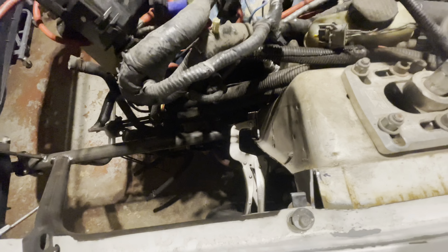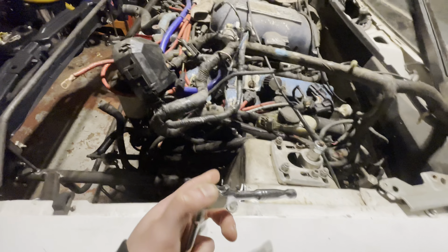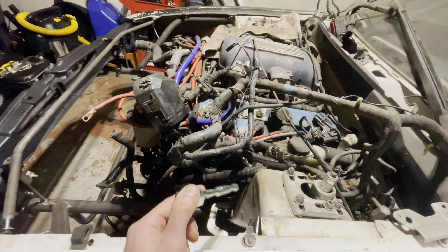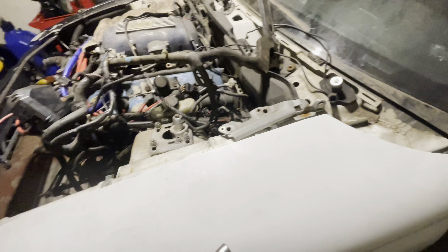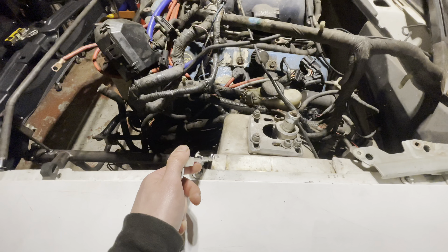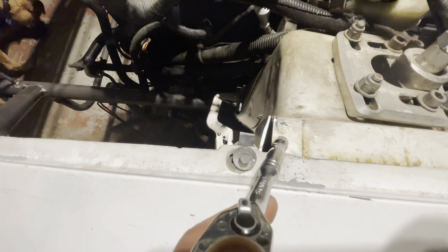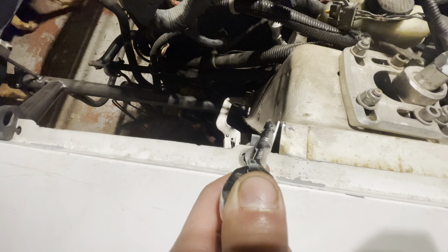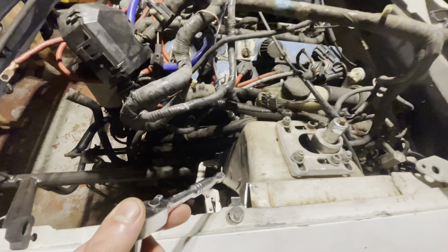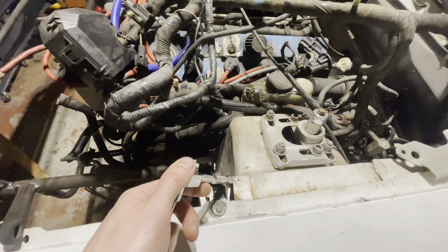As you can see, the cuts are pretty good, but I do have a slight gap here. Remember, this is the side that was crashed, so I'm going to have to probably tap this and close the gap a little bit the best I can, and we'll just fill it with weld. When you do something like this, you measure from the firewall forward 16 and a quarter inches, which gets you to right about this line right here where I made that cut. 16 and a quarter is actually the spec for a Fox body, and this is not a Fox body — you guys can tell that.